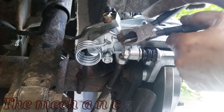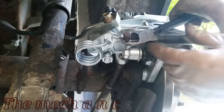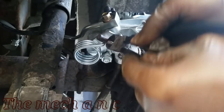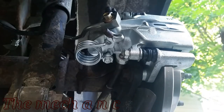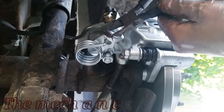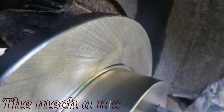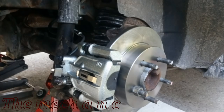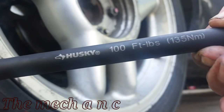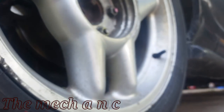It was actually very easy to get the emergency brake cable onto the new caliper, though it turns out something is wrong with the emergency brake — it doesn't work all that well, so maybe that's why. After I got all this put together, I made sure to bleed out the brake system since I did open up the lines. Hopefully you don't have to do that step. The brake system looks much better now — it's a massive improvement. Now all you have to do is put your wheel on and torque down your lug nuts.